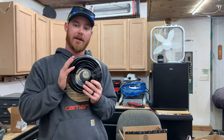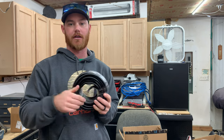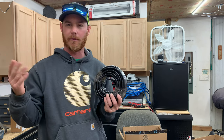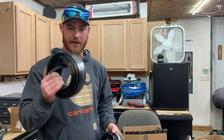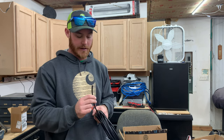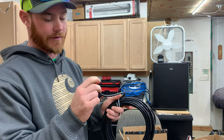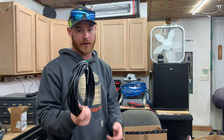On the secondary box in the back that I'm going to put on, I got this wire here. This only has four wires in it. That's going to run my brake lights and my turn signals and probably auxiliary lights, probably going to be like a reverse light kind of thing. So I don't need to have all seven wires in that loom. Then when it comes to running lights, it's only a two-wire system. You'll ground the light itself, and then you've got a positive and a negative, or ground, or whatever you want to call it. So I got this nice wire here. It's very high coated stuff, so it's not going to rub, it's not going to get water in it, it's not going to corrode, that kind of thing. 50 feet of it was like 20 bucks.